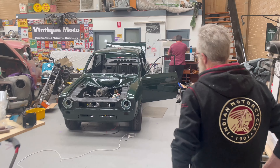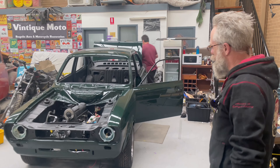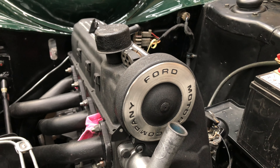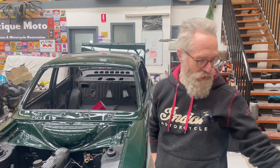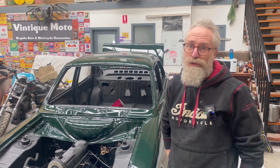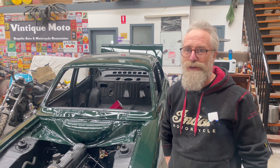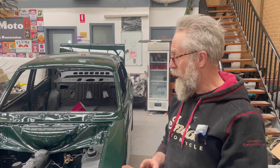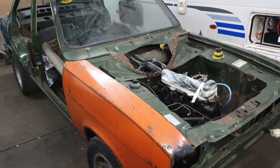And you're pretty much prepared to work on anything? Anything. I used to work at a place called Belford Garage with David Belford, doing the old 356s and 911s. Lately I've been doing quite a lot of right-hand drive conversions on Mustangs where we got the dash 3D printed to make it all look correct. When you do the dash, the instrument cluster goes down towards the middle — in a left-hand drive it goes down towards the outside and just looks wrong. So we've got everything swapped over in CAD, had it printed up, and now everything drops down beautifully and looks perfect as a right-hand drive conversion from the factory.